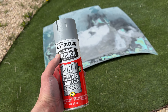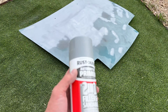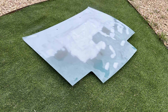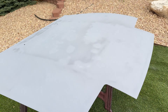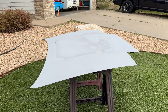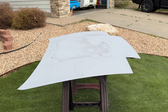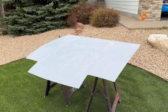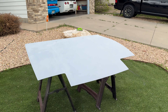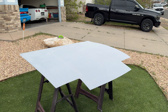Time for some primer. It's looking much more smooth now. With this filler primer it should be able to get the rest of the small imperfections out. It's all primed, so now I just got to wait until it dries and then I'm going to sand it down a little bit more. Probably throw a layer of paint on there and then I'll wrap it. It is a new day — the hood is primed and sanded down. It's not perfect but it's good enough for me. I think it looks much better than it was before.